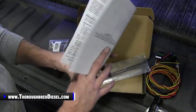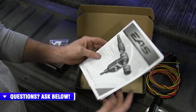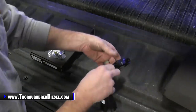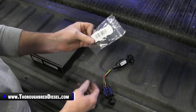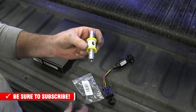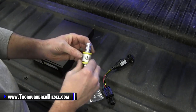That instruction manual will be very helpful for you. Now, I want to bring in another product we offer: this is a fuel pressure T from AirDog. It's a simple fitting — push to lock on both ends, half inch. All your FASS and AirDog delivery lines are half inch, so you just cut that line and splice this T in. It has a one-eighth by 27 MPT port for your fuel pressure sensor.